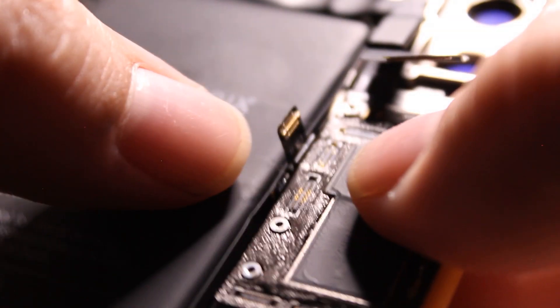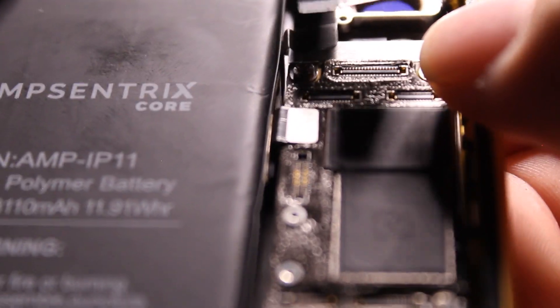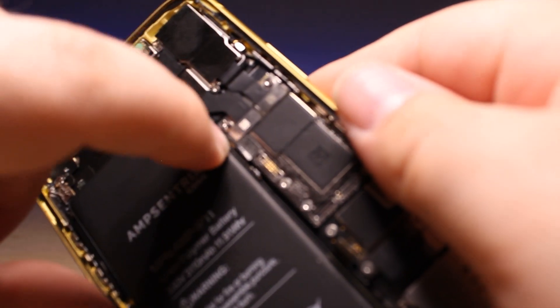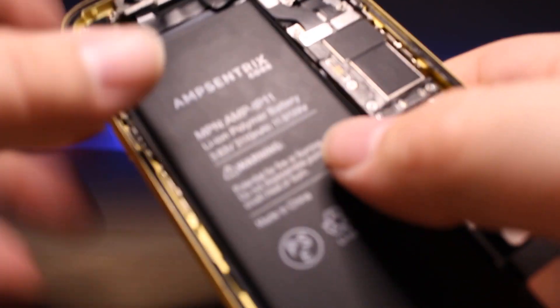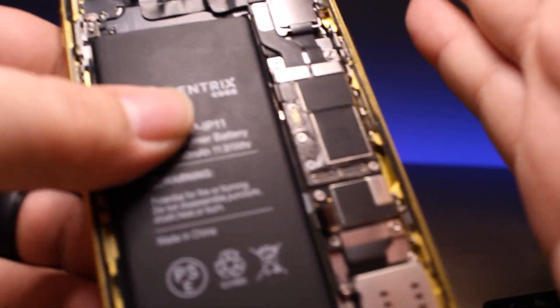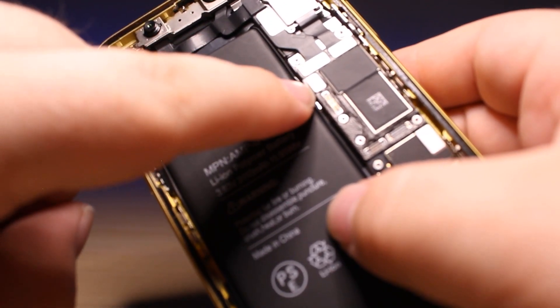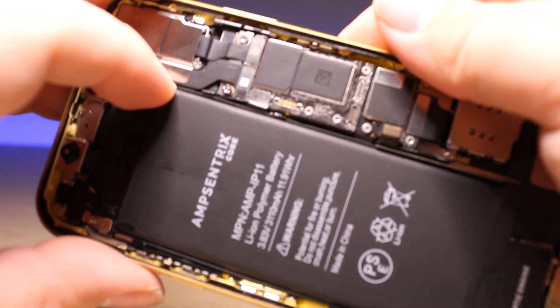The Tag-On slides down right in between the battery and should line up nicely to click in. What I'm running into now is the physical gap — I need to make it a little bigger. This battery has been replaced before, so I should be able to put a little isopropyl alcohol under it and slide it over. If that's not the case, you'll have to pull the battery tabs out so you can slide the battery to the other side to leave enough clearance, which would make the Tag-On flex fit even better. Let's take some isopropyl alcohol — now I can move that out of the way and we've got plenty of room.